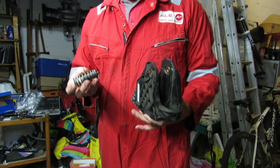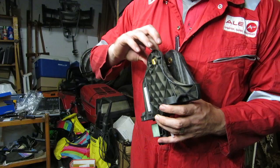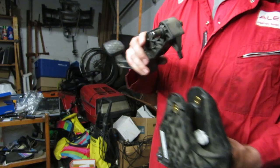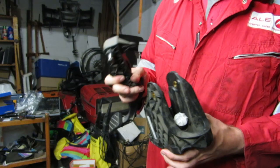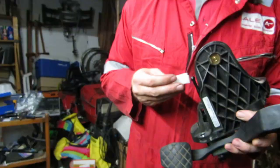Another part that I almost forgot about is this spring assembly that fits inside there. This is basically what keeps your clutch pedal popped out, and you will need to go ahead and install that together with the clutch pedal — basically like that. That little lip will go in there and we'll then install that with the white clip going over here, sliding into the pedal.